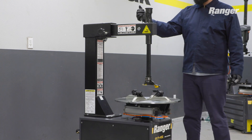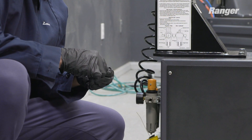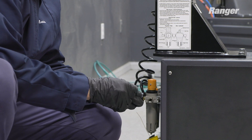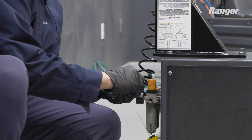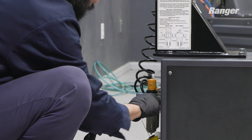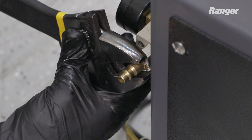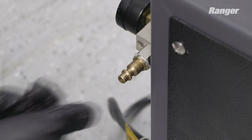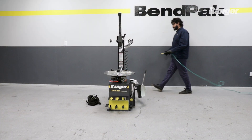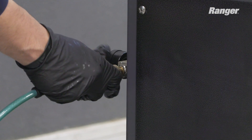You're now ready to connect your R7-45 to an air source. You'll have to connect the air source to the air inlet connector on the lubricator regulator filter, which is located on the back. The air lines going out of the regulator filter and lubricator come connected and ready for use, so no installation or adjustment is required. This tire changer requires a 15 to 25 CFM air source with an operating air pressure of 140 to 165 PSI.